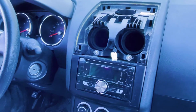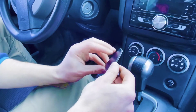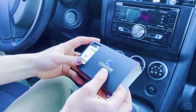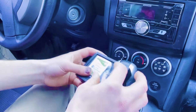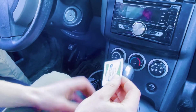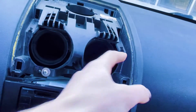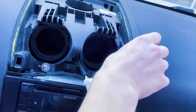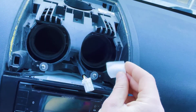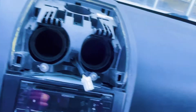In your kit it will come with this bracket and a little box of goodies. We're going to pop that open. The first thing we're going to do is take this alcohol prep pad and clean off the contact surface right here — give that a good wipe. This will wipe away any grease, Armor All, or whatever that would prevent the adhesive from sticking.